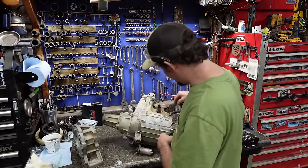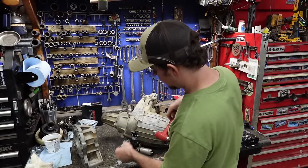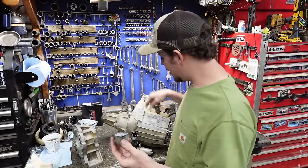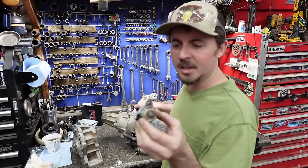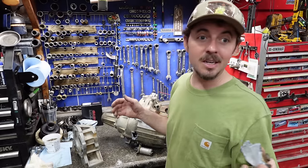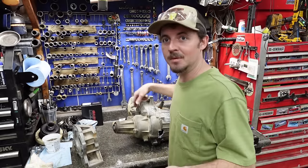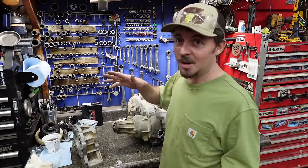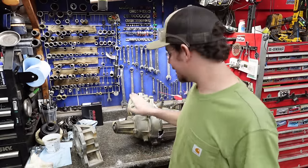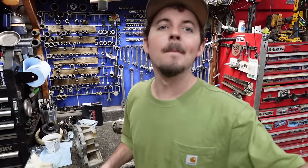And I forgot this was rusted too, and I was taking a hammer and actually busted that off there. Really probably doesn't matter, but I don't want to sell it like that, so I'm gonna take it apart, put the input shaft in it, glue this stuff up, or probably JB weld it up there, whatever. So this will work for me. Be the first Jeep with a 240 TJ with a 242 that I know of. I was gonna go with a WJ because I have even more of them, but I'm pretty sure AW4 needs speed signal. I don't 100% know that because it uses the output speed sensor, but it may just be for the cruise control, but better safe than sorry on something like this. So I'm gonna get this changed and knocking everything out.